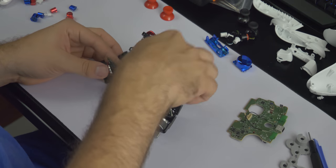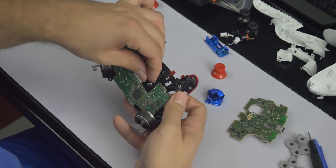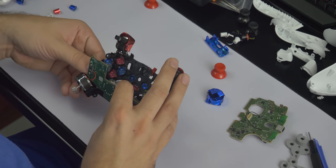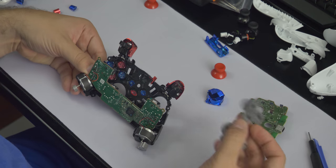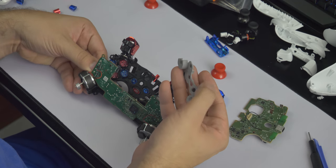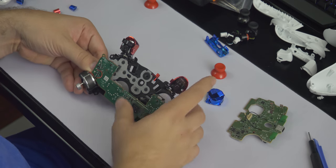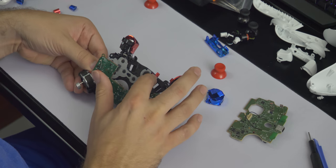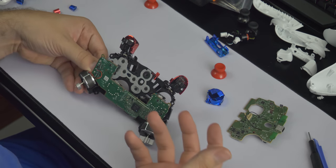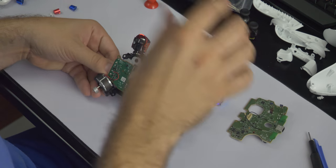Next I'm going to do my bottom buttons here. Make sure you line up whatever colors you want to put in. I decided to do two blues on top and a red as the share button — I think that's going to look pretty cool. Make sure all your buttons are lined up and definitely make sure they're pushed in as far as they can go. Next, the most important part is the rubber sleeve for the buttons — these are just going to go over top; make sure they're oriented correctly. The big ring is where the Xbox button is and the fat one is where the B button is, so that's easy to remember and it will just go right on top like a glove. Also make sure the sync button doesn't fall out — I had a couple of times where I put that in there and put everything back together only to realize the sync button had fallen out.